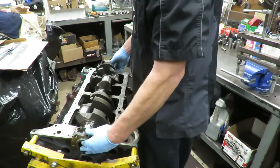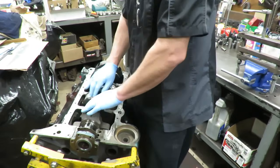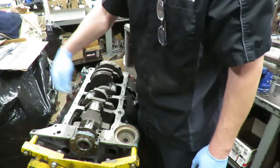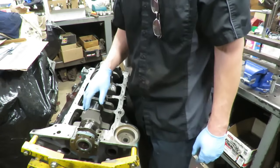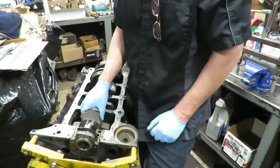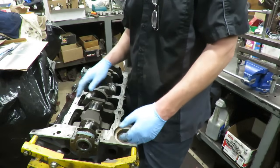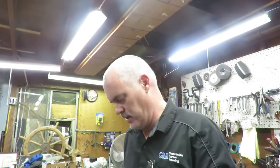Now the crankshaft, we had it cleaned by the machine shop, and we took a rifle brush in these holes in the solvent tank and cleaned the rifle brushes out. One of the things I would caution you guys, and something that I see on budget builds a lot, people compromise on cleaning. They got a dirty, nasty engine and they say, well, we want to avoid the machine shop as much as possible. And there's nothing wrong with doing as much of the work as you can, but one of the things that you don't want to skimp on when you're doing this is cleaning. Have the machine shop vat and clean everything, because dirt or grime or grit is your engine's number one enemy.